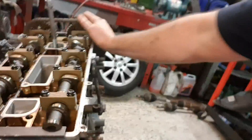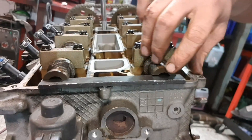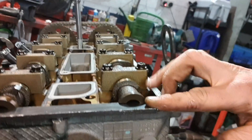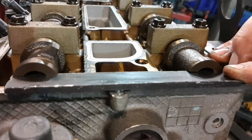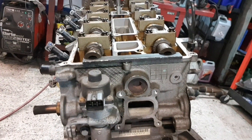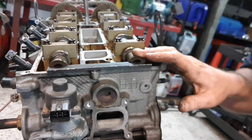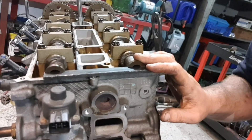So right here you can see the camshaft gets locked off. There's a groove there and a groove there, and this bar just slots in — sometimes it does need a bit of a technical tap. You can see the bar there where it goes in. Sometimes the timing can just be a little bit out with chain stretch or belt stretch, so it can be a bit of a faff about.